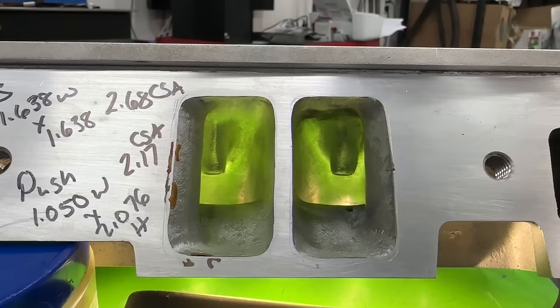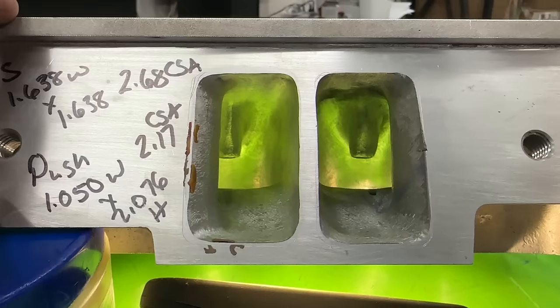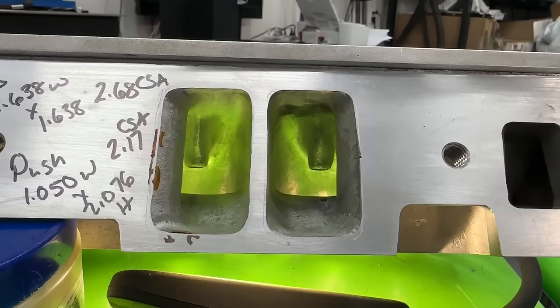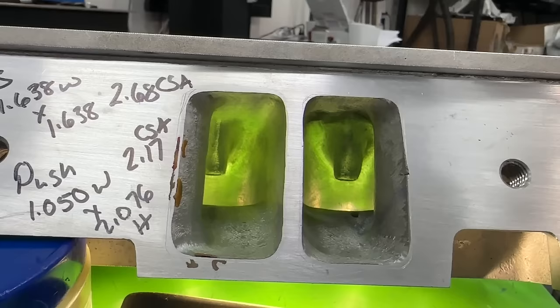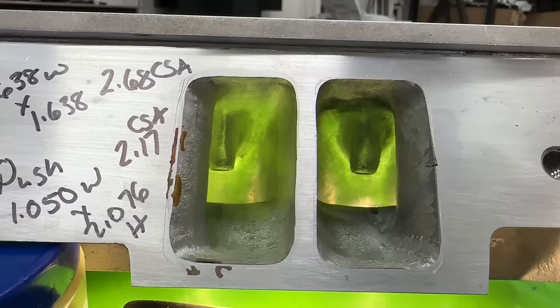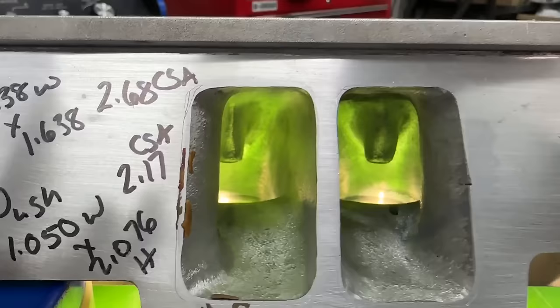Now here's the other thing that's small. I did some math using Wallace Racing calculators to calculate minimum cross-sectional area needed. For this size engine - going on the 377, 4.155 bore, 3.48 stroke - from that push rod pinch, it will peak RPM at 6,200 RPM. Now that's not guaranteed set in stone because there are things you can do to help boost that peak RPM. If you add more camshaft duration, it will bring up where it peaks. Even though the push rod says it's going to peak at 6,200, if you add more camshaft you can make it peak much, much higher. But there's a sacrifice - you add more duration, you end up losing torque at the lower RPMs, and it still wouldn't have made as much as if you'd made this pinch proper.